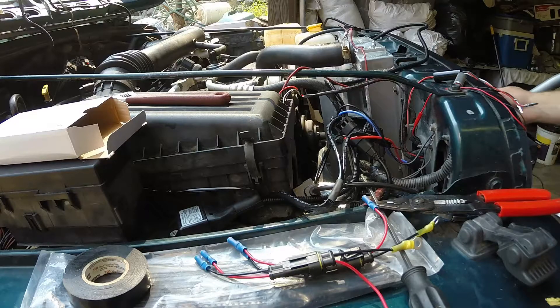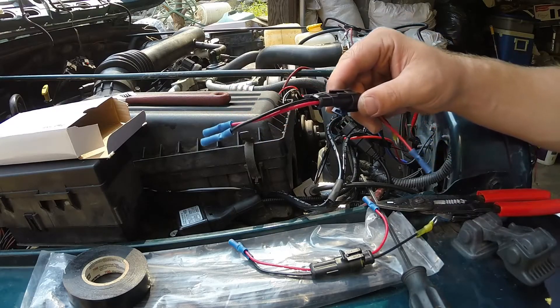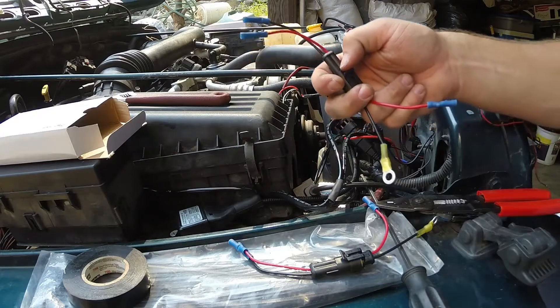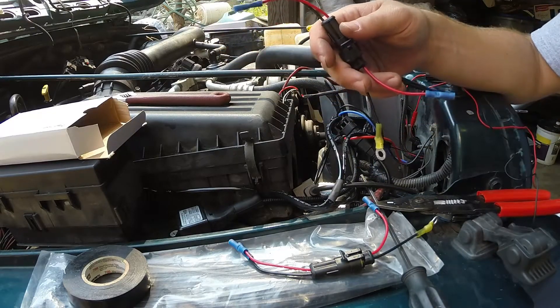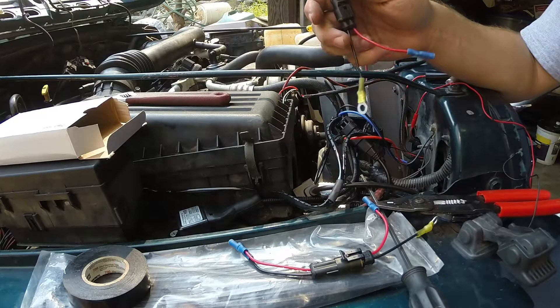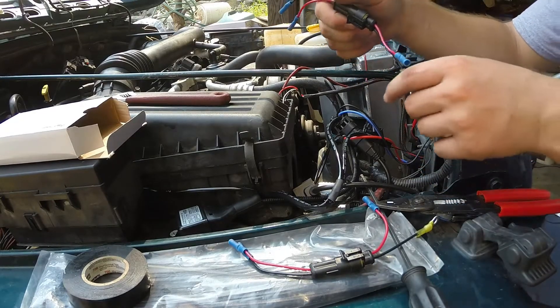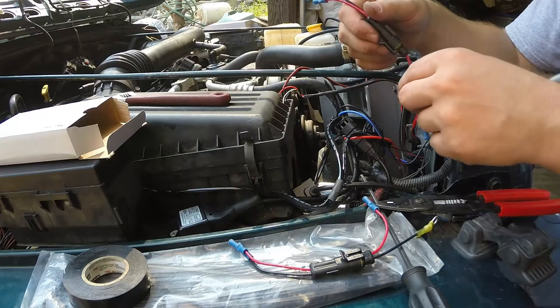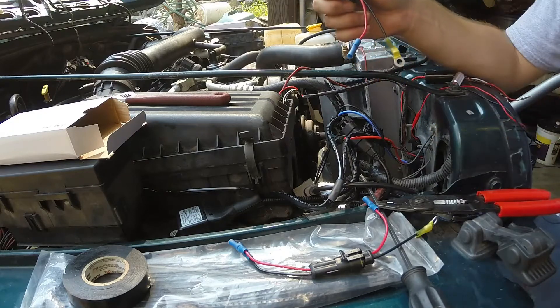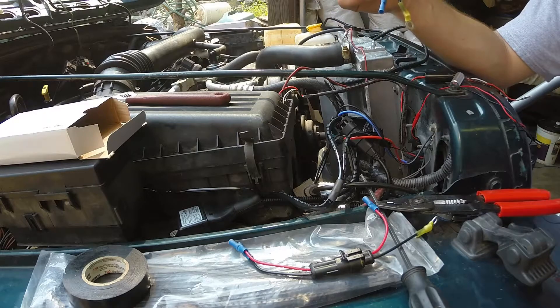Next is to wire your colored lights. I was looking for my heat shrink crimp connectors and couldn't find them — I just found some hard plastic ones. I'm not a huge fan of them; they're cheaper and less waterproof. But I also found some waterproof connectors. So instead of disconnecting the ones down low on the headlights, it'll make it easier if I ever want to take off my headlights — I'm going to connect all the reds and blacks to one so they'll have the same ground and power outlet and I can just disconnect them all at once. If you want to be able to turn on one and not the other, you're going to have to connect them separately with different switches, which makes it more complicated.